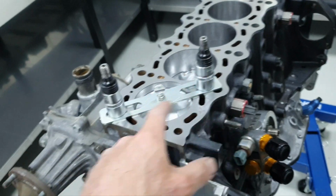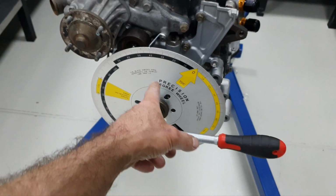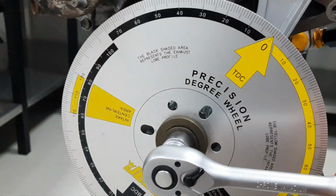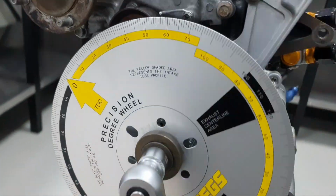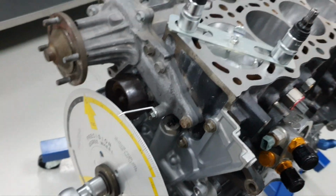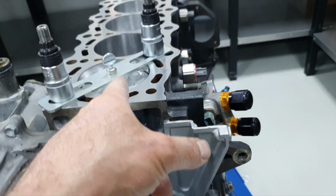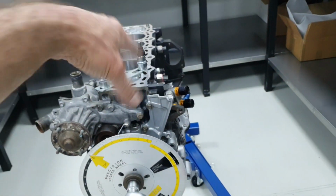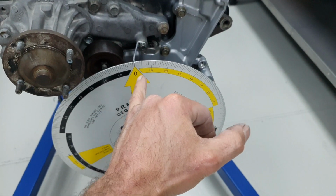Okay. Two studs, a couple of washers, nuts, the bracket. This is a stopper. All right. So I'm 40 degrees after top dead center and stop the piston there. And if I go clockwise, you're gonna see that it will stop at 40 degrees before top dead center. Okay, so when I put on zero, it's gonna be zero. Let me remove these things. Okay, bring it up to top dead center.